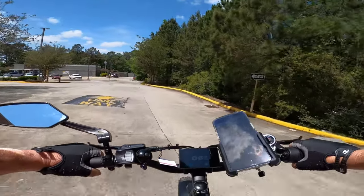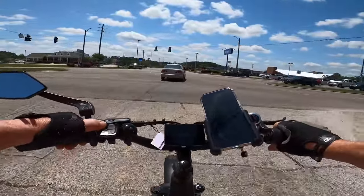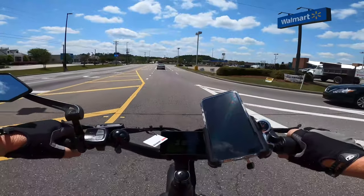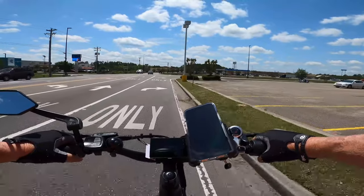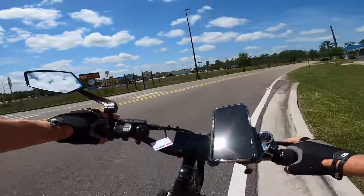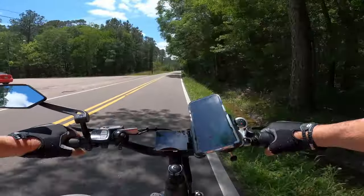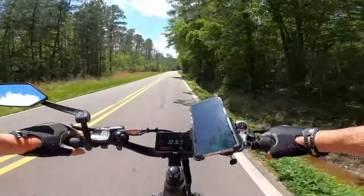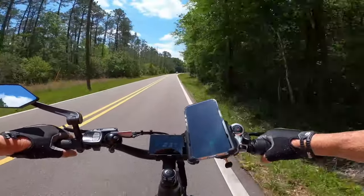Okay, y'all, we're back with you. All right, we're gonna ease on across. It's got a pretty good hole shot there with the torque. Didn't have any trouble getting out of there. So we found out with that 11-34 gear that this thing will haul the mail at 28 miles per hour and will not ghost pedal.